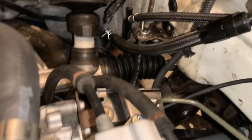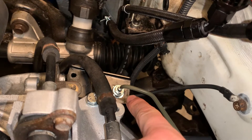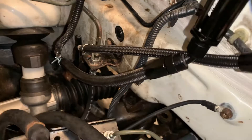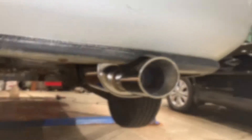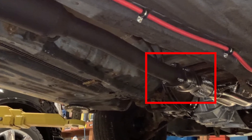After I got the car running I went ahead and hooked up the clutch line. This is actually the factory mount from my D16 clutch line that I reused, hopefully it doesn't leak. As you guys just saw, got the exhaust on, got the clutch line hooked up, just got to bleed the clutch line and hopefully drive this car out of the garage. It's been about four hours - the exhaust took a long time because there was about a four inch gap between the header and the Apexi WS2 exhaust, so we had to build a flange and a four inch pipe to go in between. I'm going to bleed the clutch and hopefully it can drive under its own power.